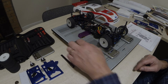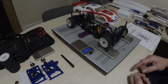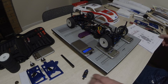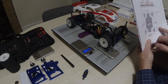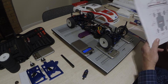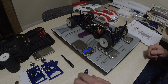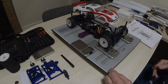We measure the shock absorber with the spring and everything on it — that's 11 grams. Since we have two of them, we take the weight of one shock and add that to our total unsprung mass. I've written down the reading on the left side, the right side, plus the shock absorber weight — the total of that is my rear unsprung mass. Repeat the same procedure for the front to get your front unsprung mass.